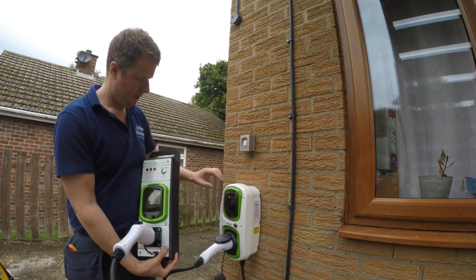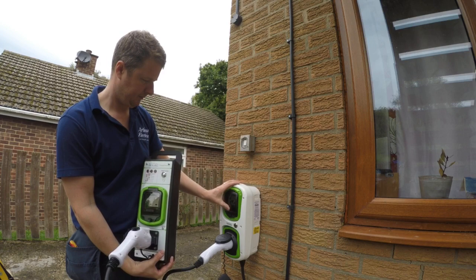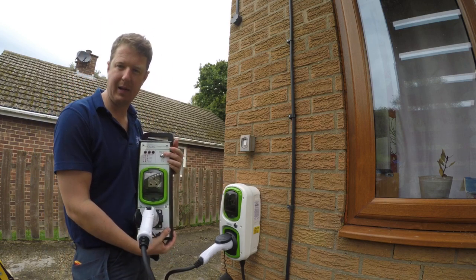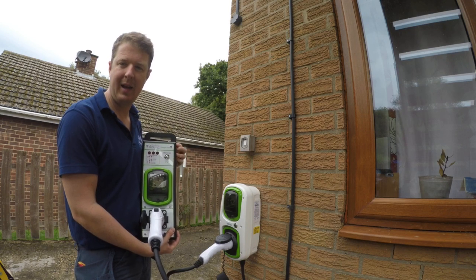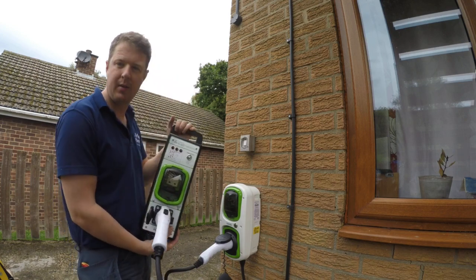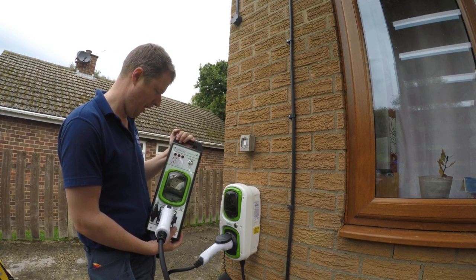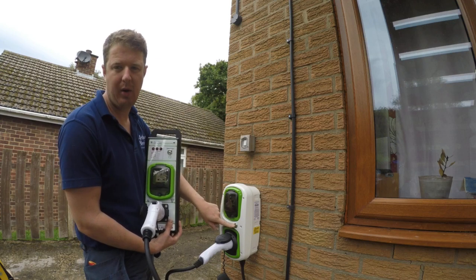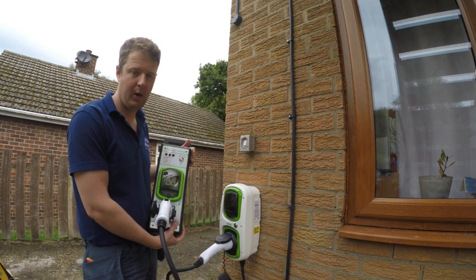My charging point RCD is turned off at the moment, so I'll put the RCD on and the socket starts to initialise. There's a press-to-test button. Press that and you can hear the contactor kicking in on the electric vehicle charging point. It has three indicators — three little red neons — which indicates that it's passed; everything's correct and working properly. The green light on the charging point has illuminated to show that it's in charging mode — it thinks it's charging a vehicle right now.